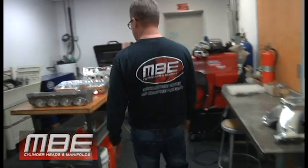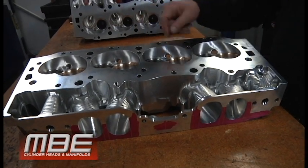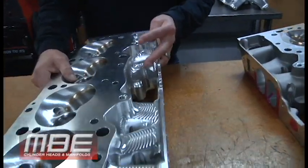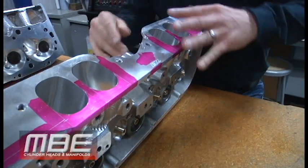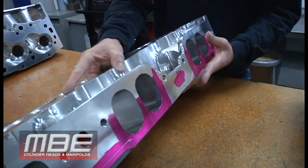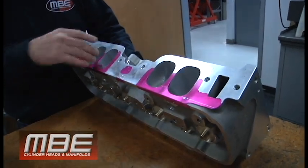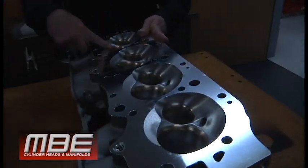We have a new set of northeast modified heads right here — this customer wants to run stainless valves, so this has a copper beryllium seat and a ductile iron exhaust. Then we have a new set of heads we're doing. This is a 2420 head — we use these on a lot of boat applications: 2420 intake valve, inch 800 exhaust. Then this is the new 20-degree head — that's an 18, this is a 20 — larger ports, higher RPM, different valve locations. This has a 2500 valve and an inch 830 exhaust.